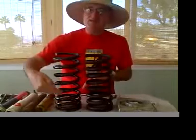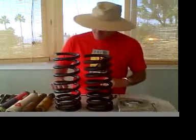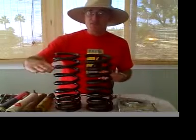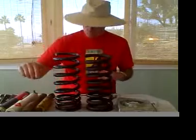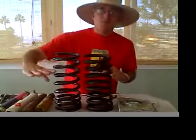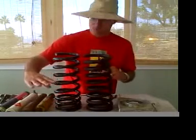You'll see that this has got uneven spacing of the spring coils. What this does is it gives you a progressive spring rate. The spring rate is softer to begin with and then gets firmer and firmer as the spring gets compressed. That initial softness gives you a comfortable ride, but the increasing firmness helps the vehicle to not bottom out.